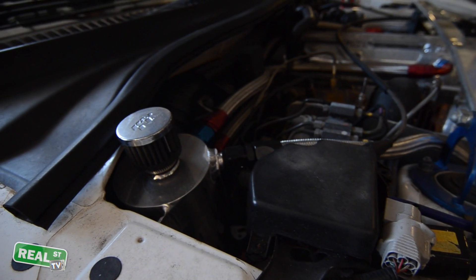In a turbocharged application, make sure you're venting the valve cover enough that you're not accumulating crankcase pressure. Once the crankcase is pressurized, the oil cannot drain freely out of the housing. You can vent the crankcase through the valve cover — generally we use two dash ten lines headed to a catch can.